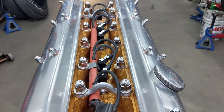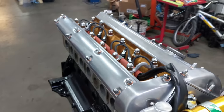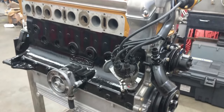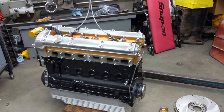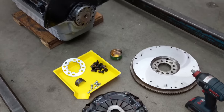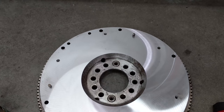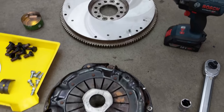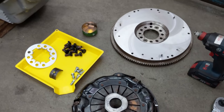Next I'm just going to throw this engine on the ground — made up a bell housing starter, we're getting closer to running. Got the engine sitting on the ground, feels like somewhat of a milestone. What this really does is lets me get access to the back of the engine and the flywheel. I can see I'm getting ready to put that on. You can see the original flywheel here — I had it resurfaced. The guys at Anderson Precision Machines said it had a couple of fallouts, so that concerns me because I don't want to put this engine out of balance.